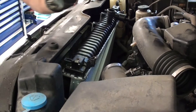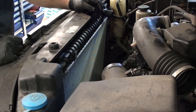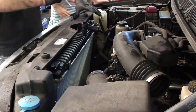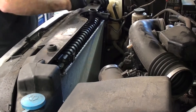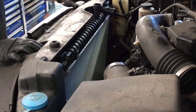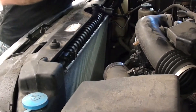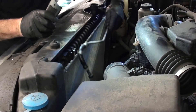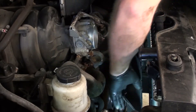Bracket for the right side. Now we can push the radiator up where it needs to be, and through the front slots we can put those 8mm bolts back in to hold the condenser onto the radiator — a little anti-seize on our bolts because of salt. Success — our AC condenser is bolted to our radiator. We've got our re-routed transmission cooler hose back down to the bottom. We're going to put our fan back in, ever so carefully so we don't damage our new radiator.